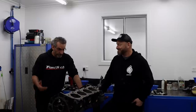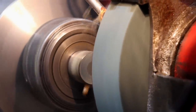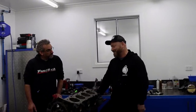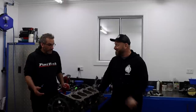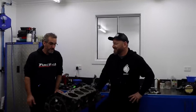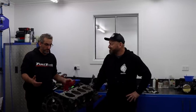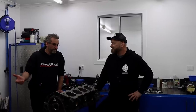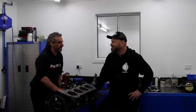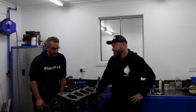We found a camshaft locally - Speedpro has got one. Lou will be on the refacer and he likes to reface the lifters to make sure they've got a two degree taper on them. People say don't use a flat tappet cam because the lifters fail all the time because of manufacturing processes. But look, I've seen roller lifters fail, I've seen steel camshafts fail, I've seen tool steel camshafts fail - which is the strongest of the strongest. I'm an engine builder that favours flat tappet cams because they're just more durable in my eyes. We just went eight zeros in a full weight car with a 23 degree small block Chevy with a flat tappet cam and it's still going today.